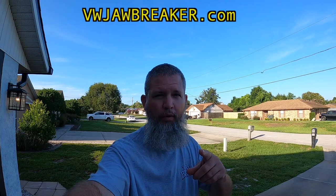I'm Gary of VW Jawbreaker, and today we're gonna get back to work on that Baja. Remember the last time we took it out for a drive? First test drive went really good. Had a couple minor issues, one of those being the pushrod tubes were leaking. I looked into it a little further. It was not the pushrod tube seals, but the actual pushrod tubes themselves.